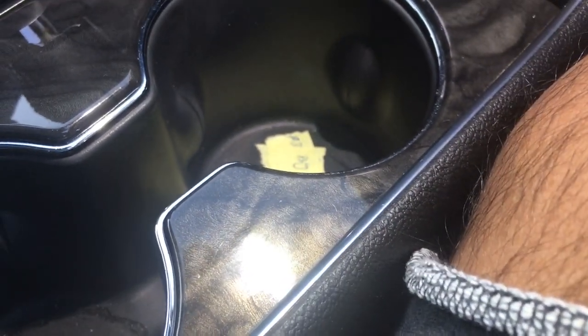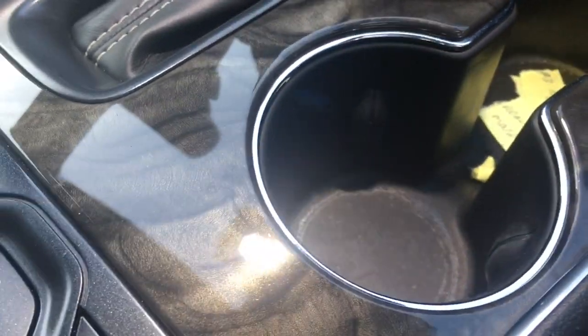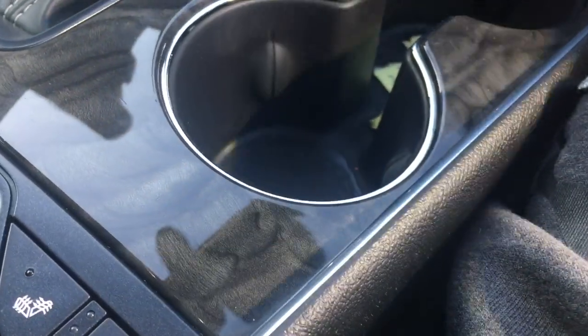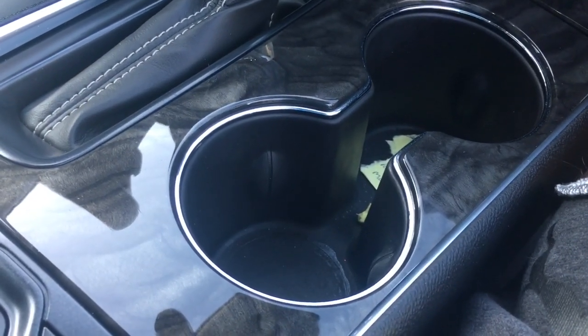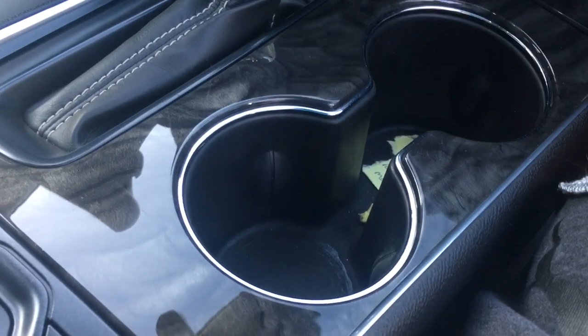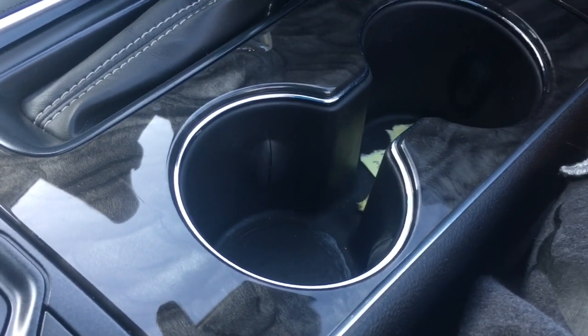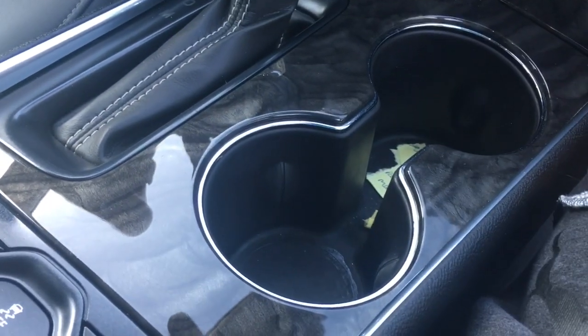It's pretty swirled up here as well, so we're just going to clean that up. You don't really need a really heavy cut polish to get results like this. I'll clean the cup holders later, but again — to get results like this you don't need a lot of polish with a lot of cut, and that looks pretty good. Now I'm going to finish the rest and put a coating on here. You can put any coating you want — a trim coating, a paint coating, your choice. I'll probably just put the Adams coating on here and see how that fares.